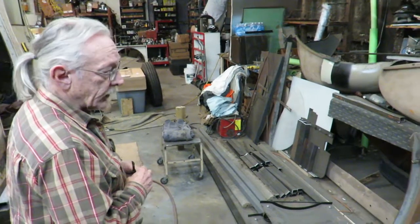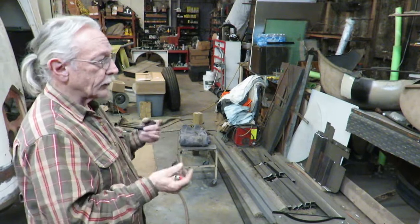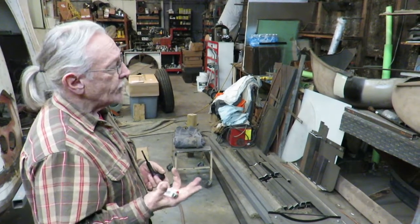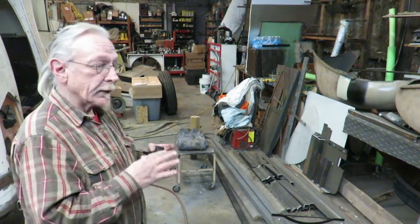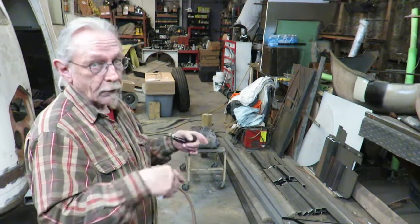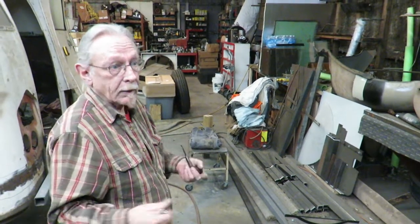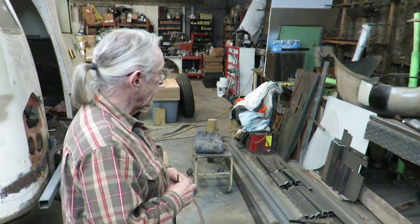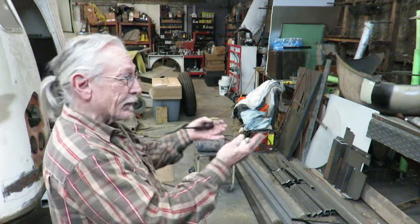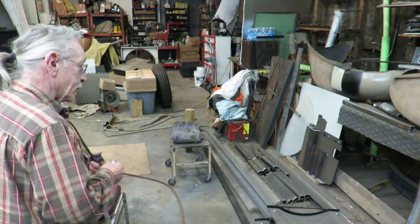One of the few things I had to replace was the inner fenders. One side was rusted and had a lot of stress fractures through it. I found a pair from a 1940 truck which are different, but the louvered portion is identical. So I just cut the louvers out and replaced the bad portion of mine with them. Now I just have to remember how all this stuff goes back together after years of it sitting around like this. That's pretty much the story.